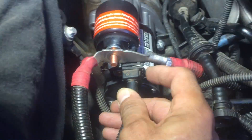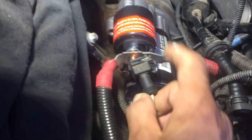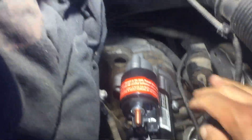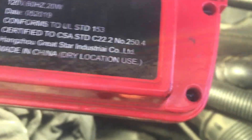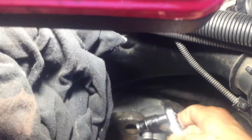It'll have an electrical connection here. Squeeze it and out it comes — push that clip and slide it out. This is the new starter — I'm showing you this so you can see what I'm doing. Now that sucker's tricky — you don't have room. You can try a quarter-inch ratchet, but let me show you — it hits up here on that plastic wall and you just don't have the room.